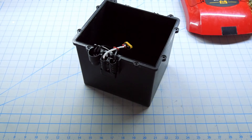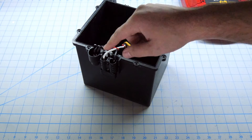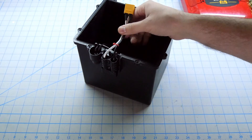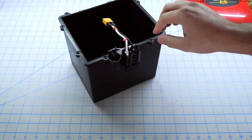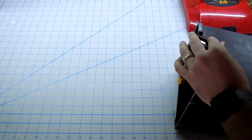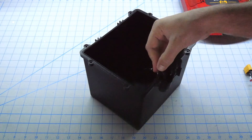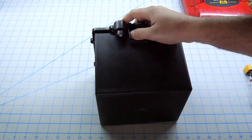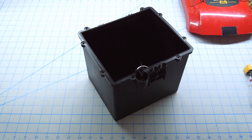This is the case where the lead-acids belong — mine are already missing, I've disposed of them. Two 12-volt lead-acids go here, tied in series for 24 volts, and that connects to the main power plug on the front. These use little connectors straight to the battery, so there's nothing special inside. I'm going to reuse this connector here. There's also a power connector next to the main power lug used for charging the battery outside the mower, but it doesn't connect to anything relevant for the LiPo install, so I'm just going to ignore it for now.